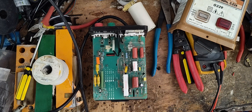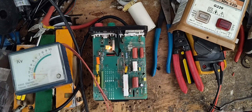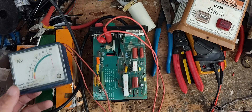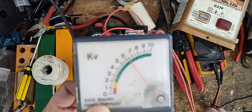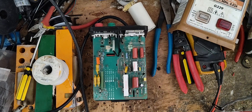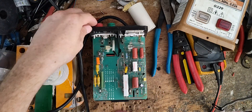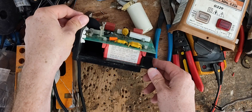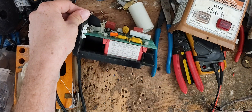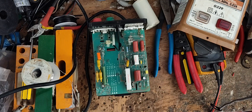37-year-old unit — all it needed was a capacitor change. Let's use this analog meter and put it across there. It should be about seven thousand volts — between six and seven on average. We're hitting almost eight. This meter isn't reading all the way down to zero, so it's probably between six and seven, which is where these things normally sit. I think on the side of the case it says peak output voltage was 7.2 kV at no load — and we're showing eight, so subtract that variance and we're about seven. At a following load, this is about 4.7 kV at 2 joules output. Yeah, this unit's done — it checks out.